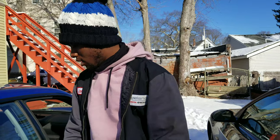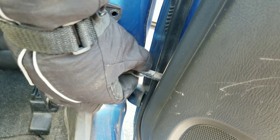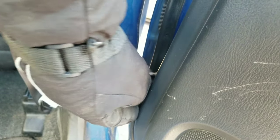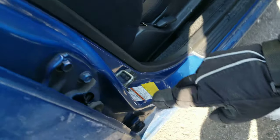There's gonna be a little door stop right here — you're gonna want to take this out, it's just a 10 mil. You take it out, screw it back in, close the door so it can be compressed back in, then slide it back in. Once you do that, close the door — the 12 mil bolts over here are for your hinges, and you'll also see your connector right there.